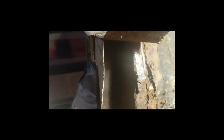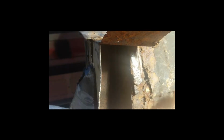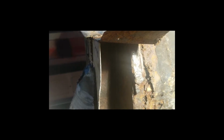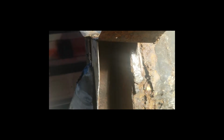And then I've been looking at the floor as well, which I thought was in better condition, but as I go through it I can see actually again that here they've welded a piece of metal over. Well, you can see all the layers in here, and that's rotted through, but again I don't want to replace all of this if I don't have to. So, although we can see the rust, I think if I clean it off and put some anti-rust stuff on and then repaint it and underseal it, that should be okay. So I'm going to just try again patching like they have in fact previously for now. That is to say, just lay a patch over, clean it off a bit better, and then lay a patch over it, I think is the way I'm going to do it.